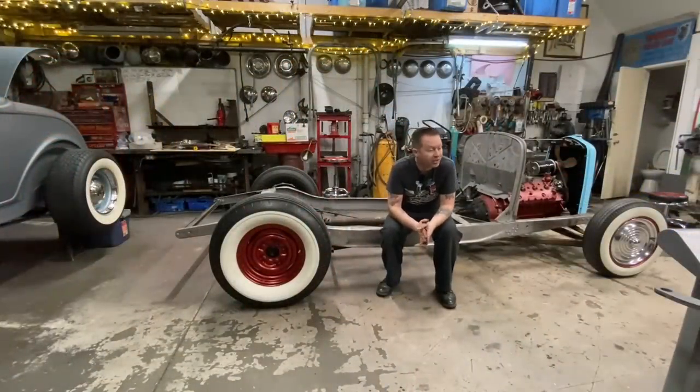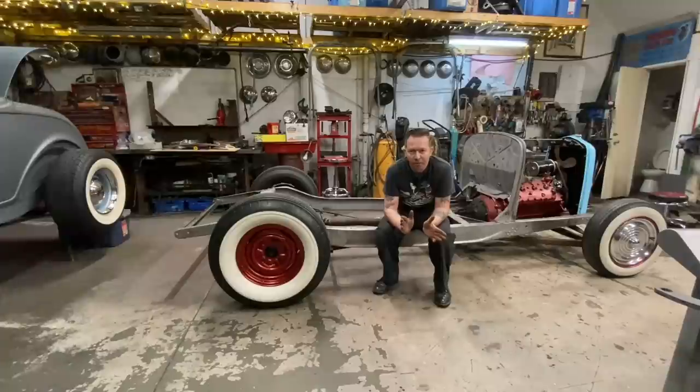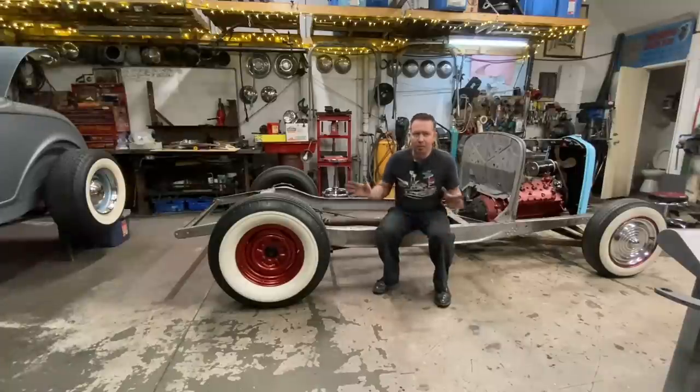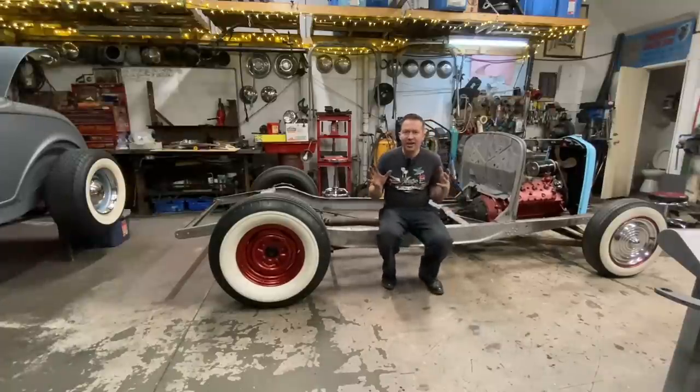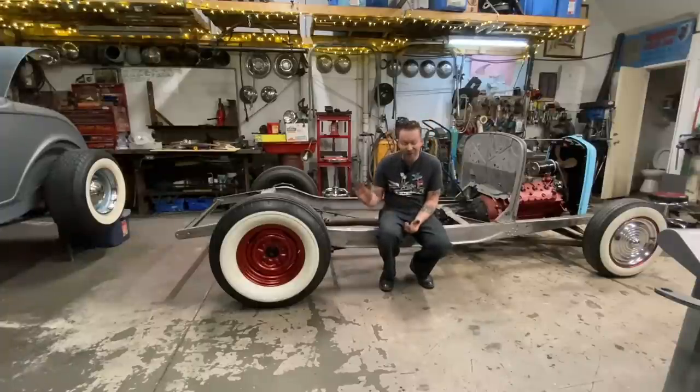So I think I'm going to call this video here. I hope if there's anything that you guys took away from this video, there's two good things, two lessons from here. One, the importance of mocking it up before you final weld everything, tack it, put it all together, and make sure that everything's going to work properly. Because when it's only tacked, it's not a huge deal to fix it. If it's fully welded, this would have sucked.